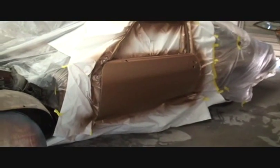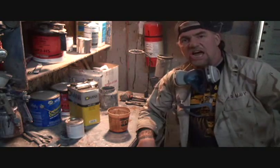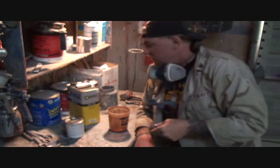I also went ahead and over-purchased paint on purpose, so if the owner isn't happy, he can go ahead and blend into the fender and the quarter panel later on down the line. Right now he can't afford that and just wanted to fix the door only. But the real reason we're making this tutorial is because we have to match the texture, the sheen and the shine to the original. There are two steps in mixing your clear up to match the texture or shine when you're only painting single panels. Even if I was blending the paint into this vehicle, I would still have to match the clear coat, because it would look really funny if we had a show car shine on the door and then everything else was dull.